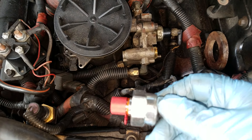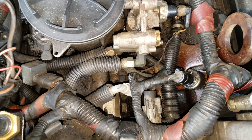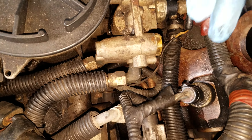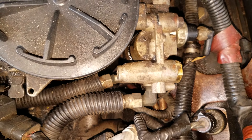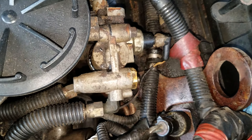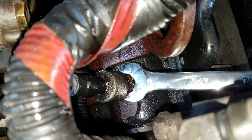I've got my new one here. What I like about the new ones is you can actually use a one-inch wrench on it. This old one here is rounded off and you have to have a crow's foot to get underneath it. If you don't have a crow's foot, what you can do is pull this wiring harness up out of the way a little bit and come in from right here.